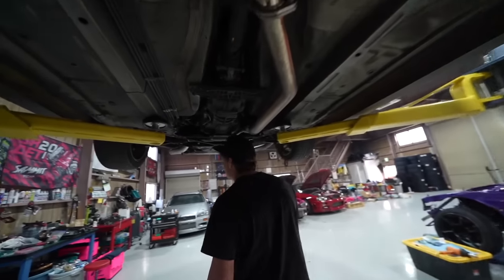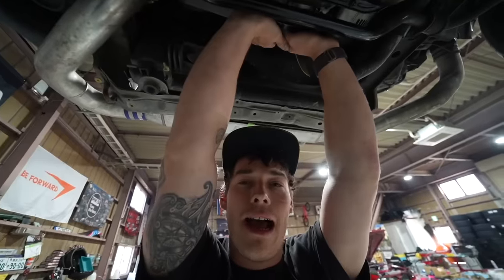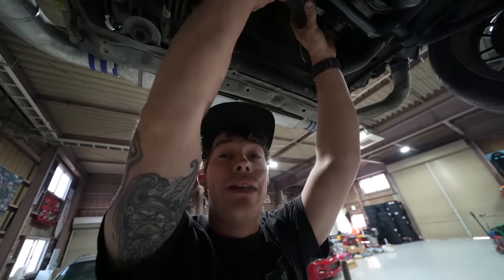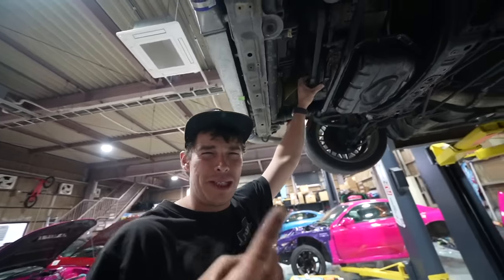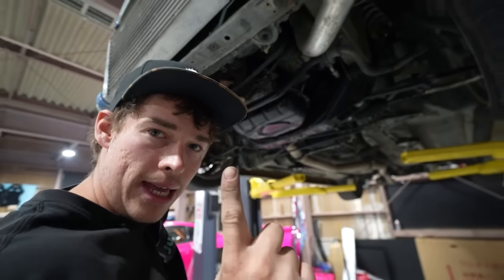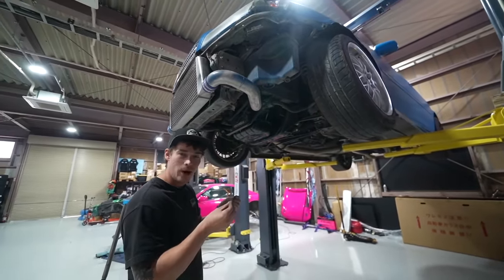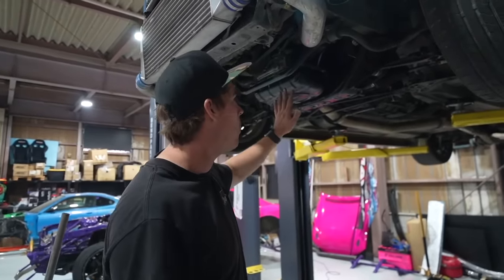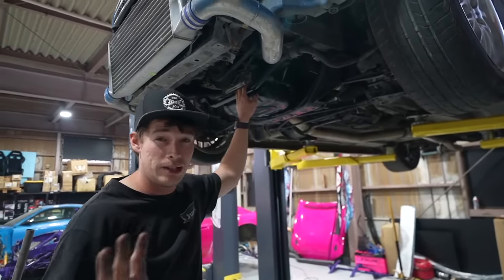I mean, mainly cars are all the same, and Dudley, he actually just had to untime his 2J and they're literally identical. So I did watch him and help him with the process as well. The only thing I don't love is setting the VVT, because it kind of moves a little bit. I've only done it once and that was on an NB Miata. When I pulled the gear off, I pulled it off wrong and all of the needle bearings fell on the ground. I was absolutely devastated. Don't want to do that again, which we don't have to pull it because we're not going to be doing cam seals. So that's all right.